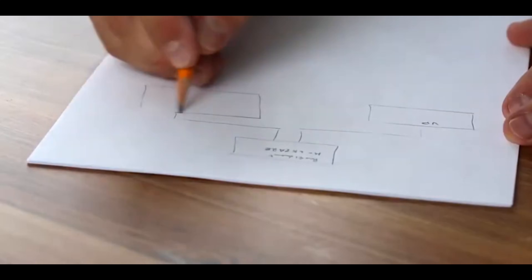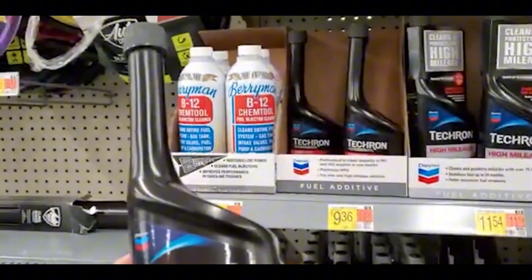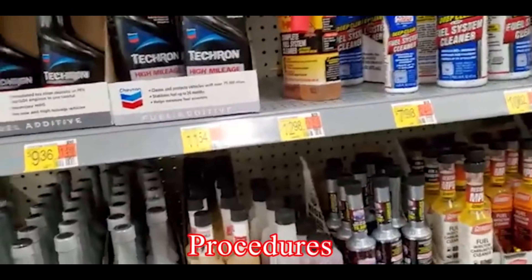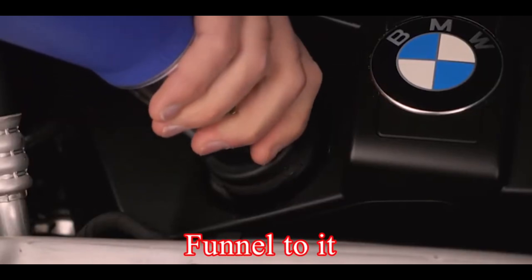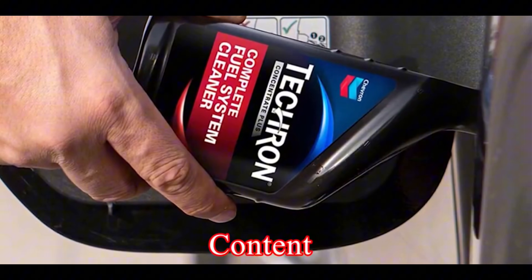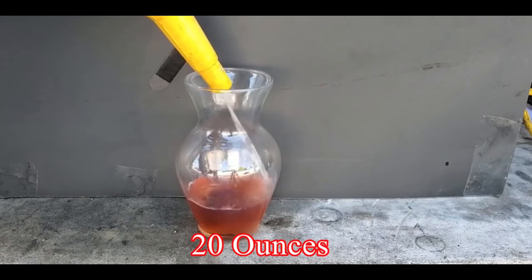Step 2: read the label for dosages. Though the steps below are based on Chevron Techron Concentrate Plus, double-check the instructions on the specific bottle you purchase, because if you purchased a different brand it might have slightly different procedures or recommended dosages. Step 3: locate the gas tank — pop open your car's fuel door, locate the gas tank filler neck, and place the funnel in it. Step 4: add the cleaner. Using the funnel and holding it in place, carefully pour the contents of the Chevron Techron Concentrate Plus bottle into the gas tank, typically 20 ounces. Step 5: fill up your tank with fresh fuel. This will help dilute the cleaner to the proper concentration and distribute it throughout the fuel system.